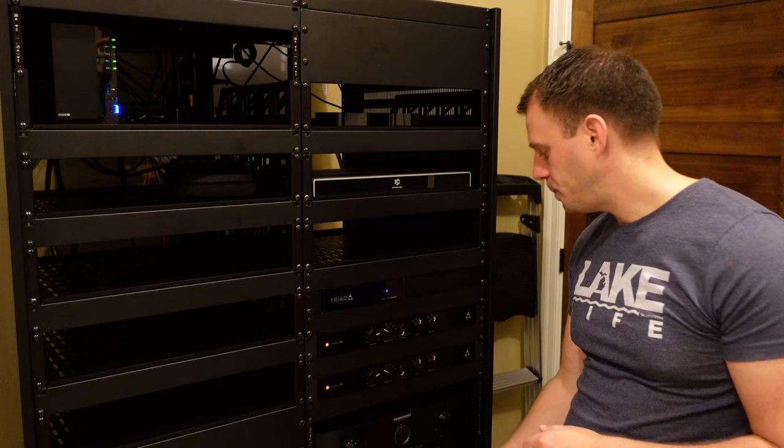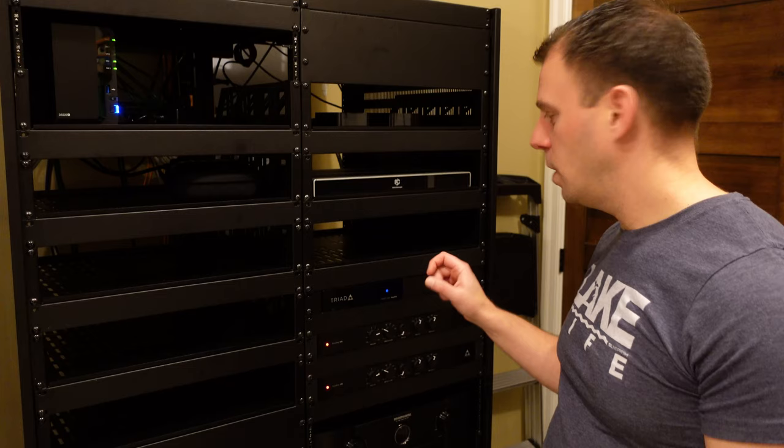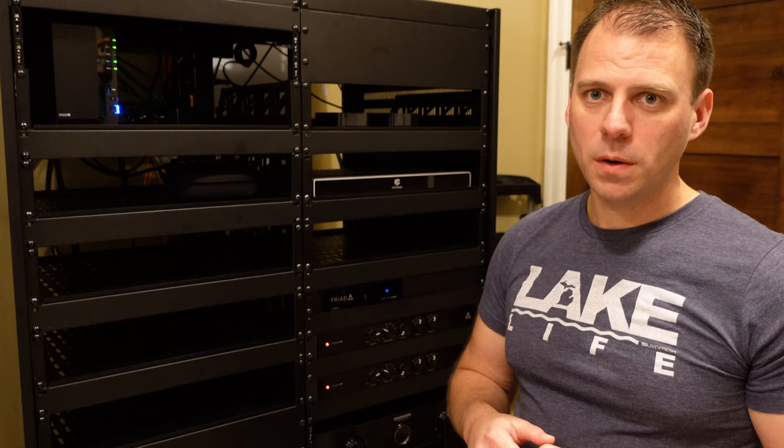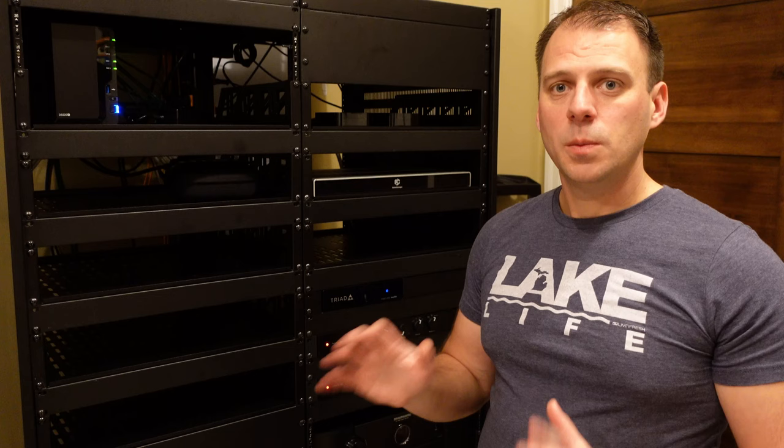Don't mess with the auto-sense. At some point something's not going to turn on, something's going to turn off — it's just not worth it. A couple cheap cables, we're talking 3.5mm mono audio cables, dirt cheap. Even if you need the screw terminal split one I showed on Amazon, it was like $8 for a pair. Cut them, strip them, use them as needed — I cut them to the specific lengths I needed. All the trigger wiring in the back of the rack is nice and clean. 12-volt triggers — use them every single time. If you have any questions, post in the comments.